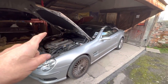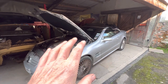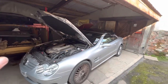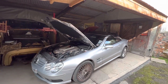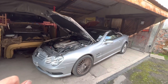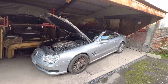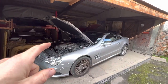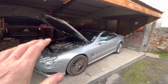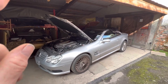A salutary lesson: I knew we needed to add engine oil because I tested it on the dash a while ago. This car developed an oil leak over the last few months and I assumed it was a drip from the engine or perhaps the rear main seal. Then something very strange happened — on the motorway I went to overtake and put my foot on the accelerator, the engine revved but the car didn't change into gear. Prior to that I'd noticed the gear changing when cold was a little slow and laggy. When I tested the transmission pan oil it was very, very low. The only other time I've experienced that is in our Pagoda when we were low on gearbox oil, and I think that's the problem with this car.